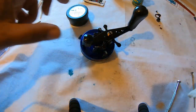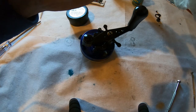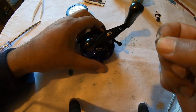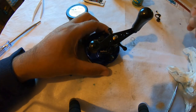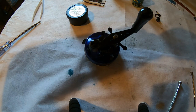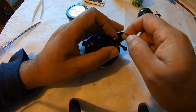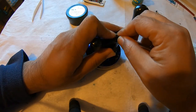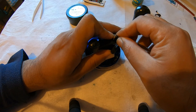Now, if you do have a pinion support, then obviously you fit it about now. Because I haven't got a pinion support, and this is totally standard, we just do reverse whatever's there, so that goes in, and then the little C-clip. Use a bigger screwdriver here. Get that off. There we go. Push it in. It goes in.